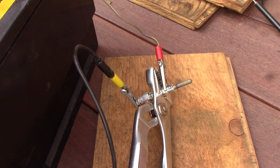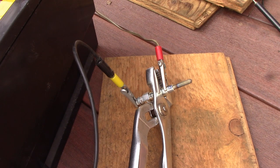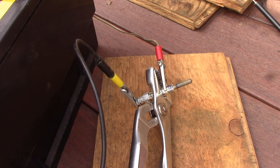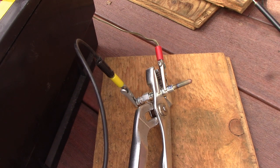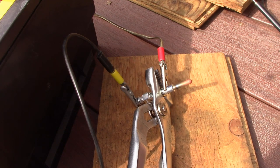My other small UPS batteries ran out so I'm going to have to use this big car battery. There we can see it starting to glow red on the end - that's about how much it glowed on the other ones. You can see more of this is getting red, most of it getting red there. It could just be because I'm using a bigger battery with more juice in it, so it's not really a fair comparison. But there you have it - it may be worth changing your glow plugs out; $14 a piece times three is probably not a bad price for some preventative maintenance.